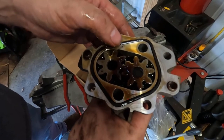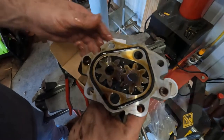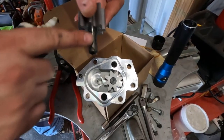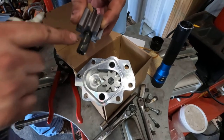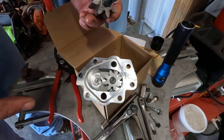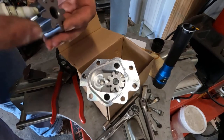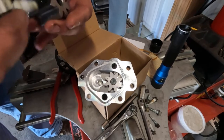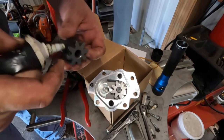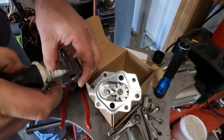So we're going to go ahead and get this new pump put on and see what it does. Now I'm fixing to lube up these gears before I put this pump on. I'm just using engine assembly lube — you can use oil or anything you have. It's just going to help out during the initial crank up until that pump gets primed up.